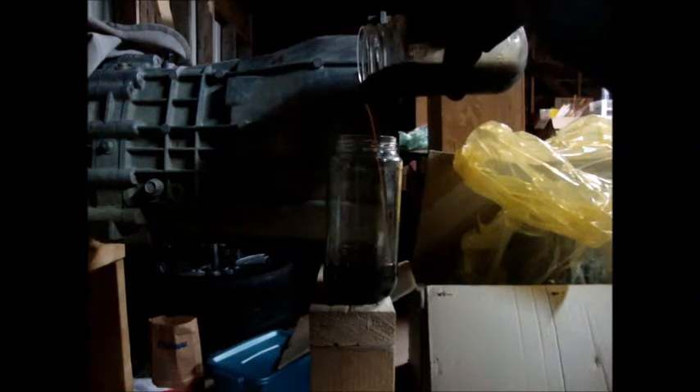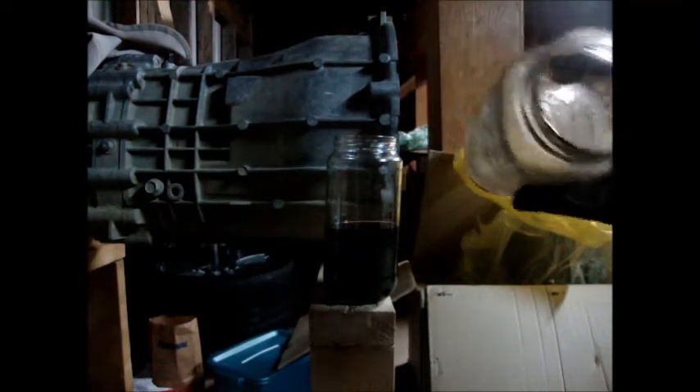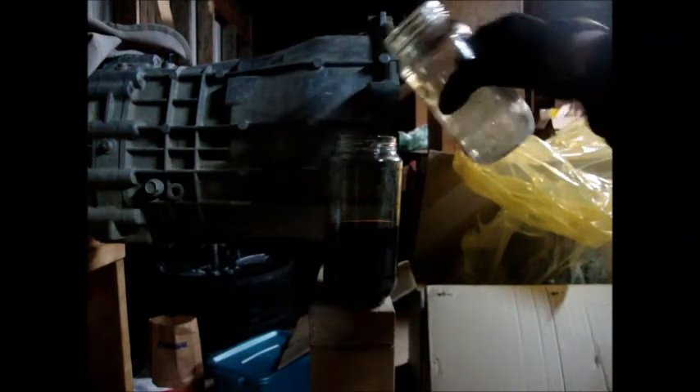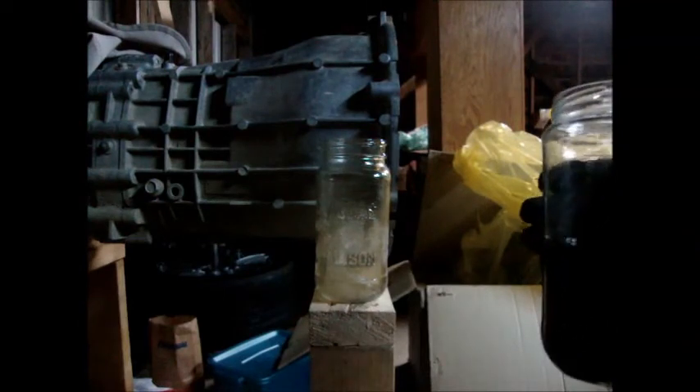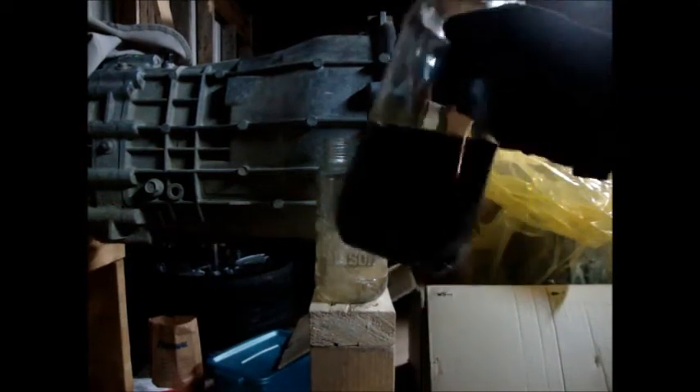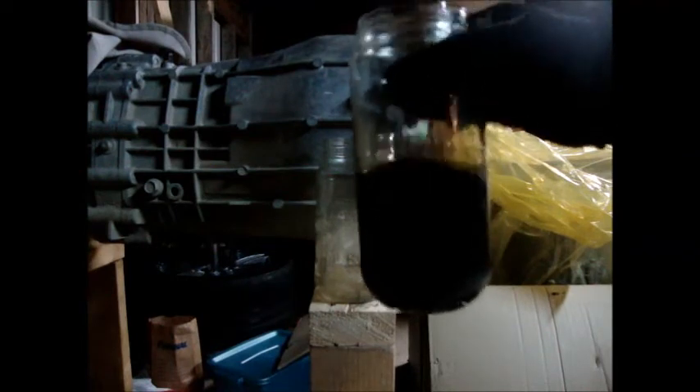It pours like conventional motor oil. Actually, I've seen conventional motor oil be less fluid at negative 18°C. So Hyundai, despite changing the fluid, might not have needed to. Obviously there were issues with the transmission, but was the fluid the problem in the first place? As you can see in this clean jar, the oil is pretty liquidy even at negative 18.